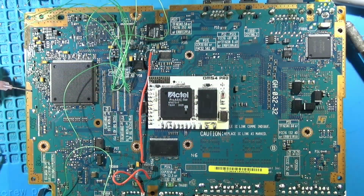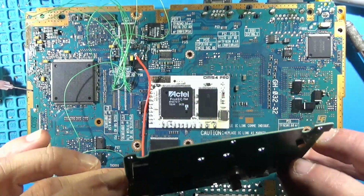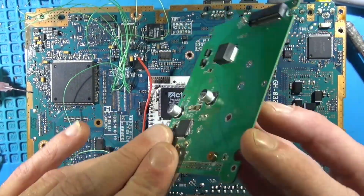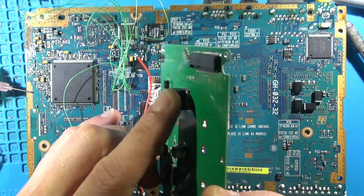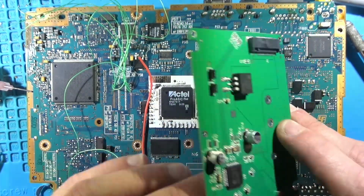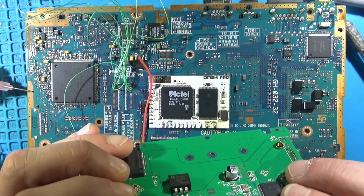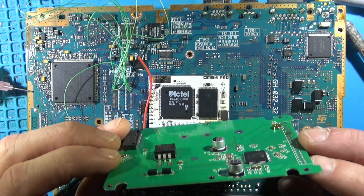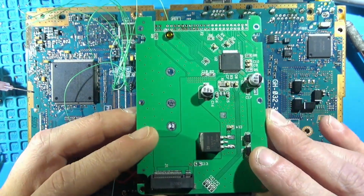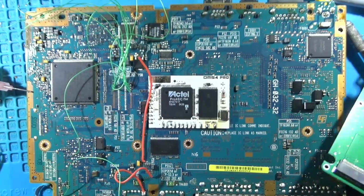C'est la vie. Okay, there's been some developments here. Yeah, the ribbon's not gonna work. This guy is not going to fit underneath the board here, because the capacitors, the voltage regulator, it's all a bit too tall. Now, maybe some modifications can be done to a board like this, using a smaller VREG, smaller capacitors, bring the board down in its height a bit, or potentially a custom PCB using smaller components. I don't know, that's outside of the scope for this video, but I do have another idea.